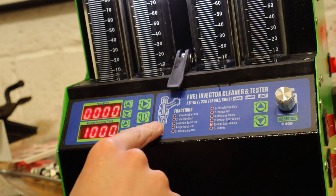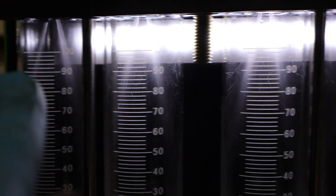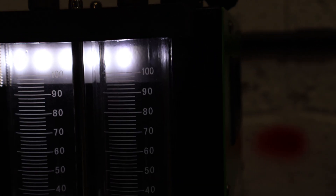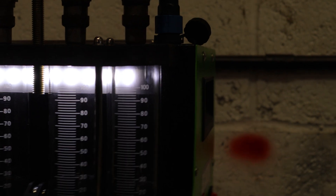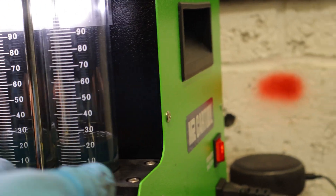So there's one full injector. You can see the spray patterns on these are bang on. And then look at this pattern — right side. This one's a higher spray. These are all three lower.